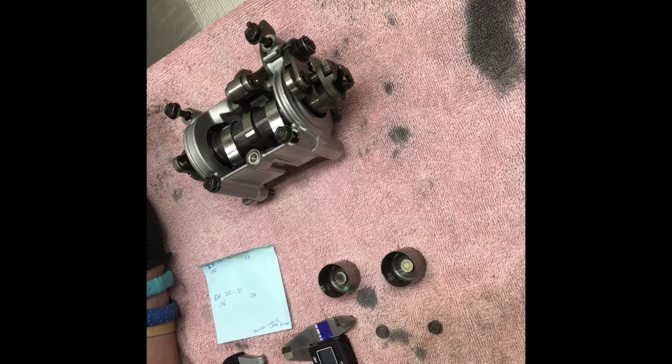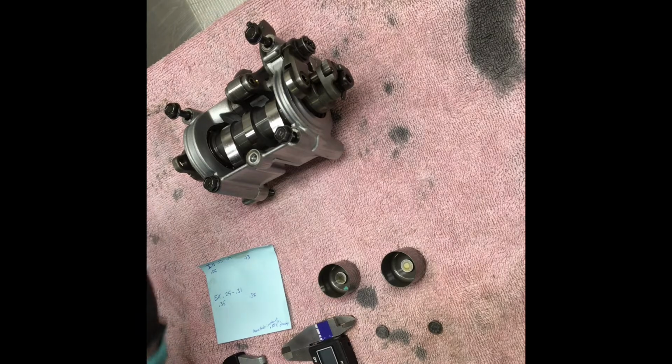If you have the extra cash, please invest in a set of these. This will be very exact. You cannot mess up that measurement. This can. Like if you ever open it up and close it and you notice it's 0.01 or 0.02 millimeters off, that's why. Digital ones are known for that. If you have a dial one, it's much closer, but you still have to adjust it the same way you do these, but it's a one-time adjustment and you rarely do it.